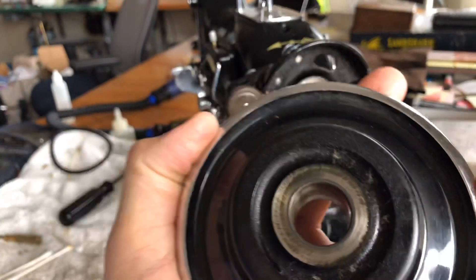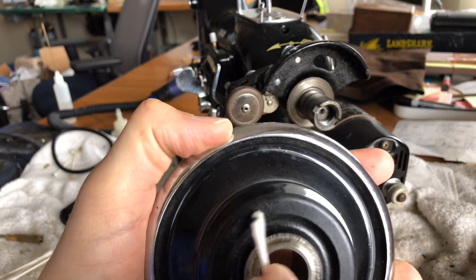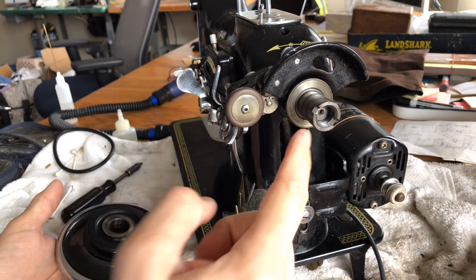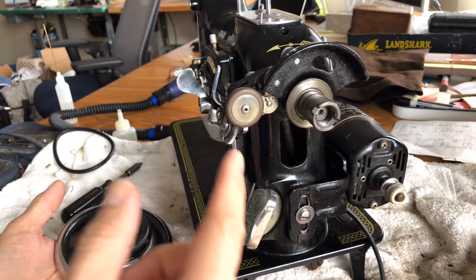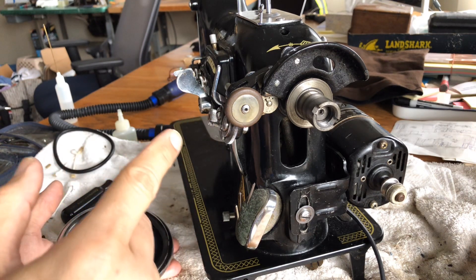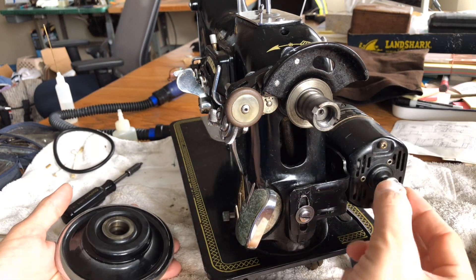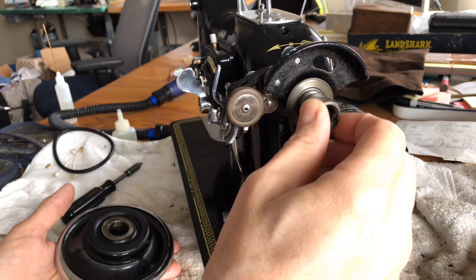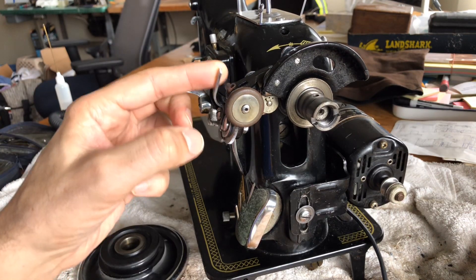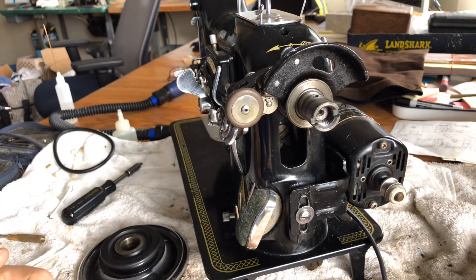Often, what you see on the other side of your hand wheel is nothing particularly special. You might see some dust bunnies, which I see here, and a little bit of grease — that's normal. One thing to look for when you're doing this is that sometimes thread — and I think I've covered this in some troubleshooting videos — thread has an interesting way of finding itself into things that spin. You can end up with sewing thread wrapped around the pulley of your motor, or on the drive shaft that your hand wheel is attached to. That often can happen because the bobbin winding goes on right in front here, and any thread that gets loose will find itself there.